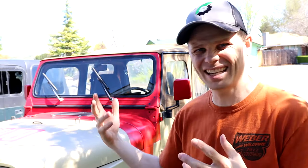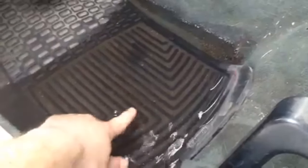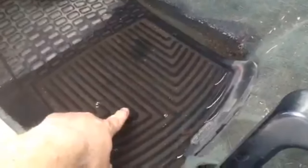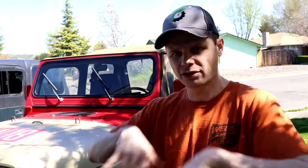All right, here we are. We made it to Jason's. So this is actually kind of a common issue with some of these older Wranglers. He's getting that old leak from his dash somewhere — it's starting to fill up his floorboards. We did the typical check of the cowl vent. I have a video on that; I'll link it up here and in the description below. Sometimes the cowl vent fills up and overflows into the back of your dash and just floods your floorboard. We've already checked that on this Jeep. We're going to run a hose in the cowl vent to double check it, then look around the window seals and a few other places to try to figure out where this thing is leaking from. So let's get started.